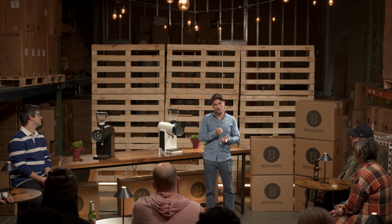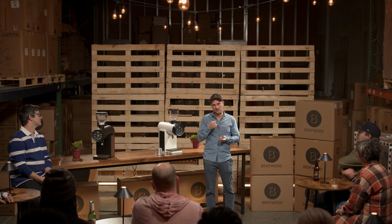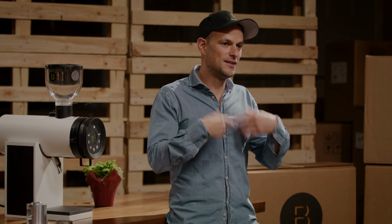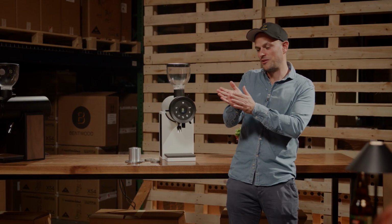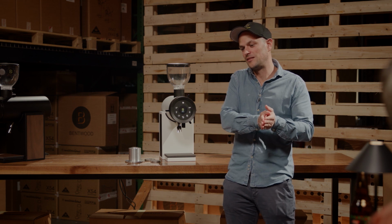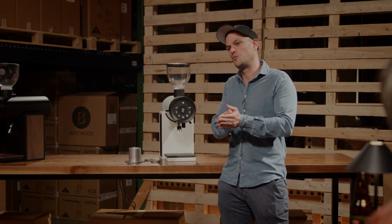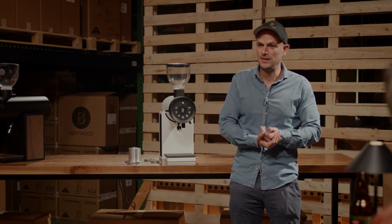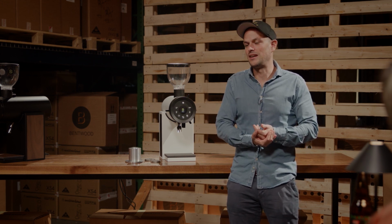Surprisingly, the worst for the grinder is if it runs without having any beans. People think, oh, I can leave it on anyways, no beans going through is no work for the grinder. Reality being, as it keeps spinning at 1,400 RPM, and there's nothing it can transport, not even that bit of heat, it will get hot the fastest when there's no resistance and nothing to go against. And that's where you have issues.